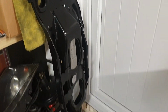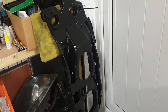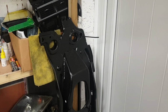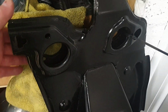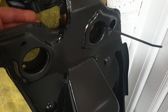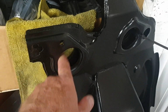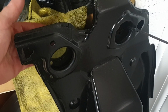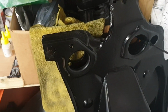That's a subframe, that's the rear. They call it the suspension cross member, but everyone else just calls it a subframe. So this is where the bushes go. That sits on the back end of the subframe, close to the underside of the car. What happens is the rubber in the bushes fails, and this edge, this face, gets close to the underside of the car, and it starts making a horrible crashing noise when you go over bumps.